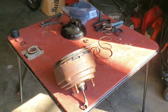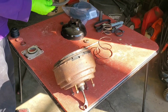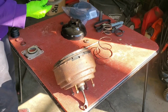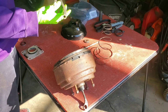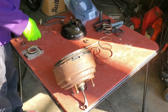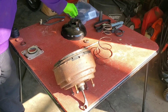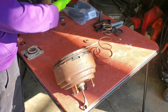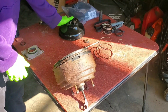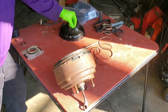I've got everything for the brake booster laid out here on the table, kind of in the order that I took it off. First, we've got the hose for the check valve as well as the valve itself — we pulled that out as one piece. It actually has two hoses on it, and unfortunately our rebuild kit came with the wrong one, so we'll have to deal with that at some point. Then there's a grommet that goes in the hole for the cover, and of course we took the front half off and painted it.